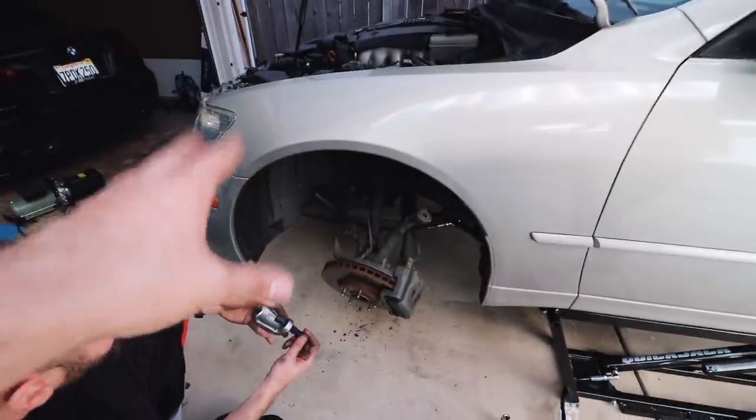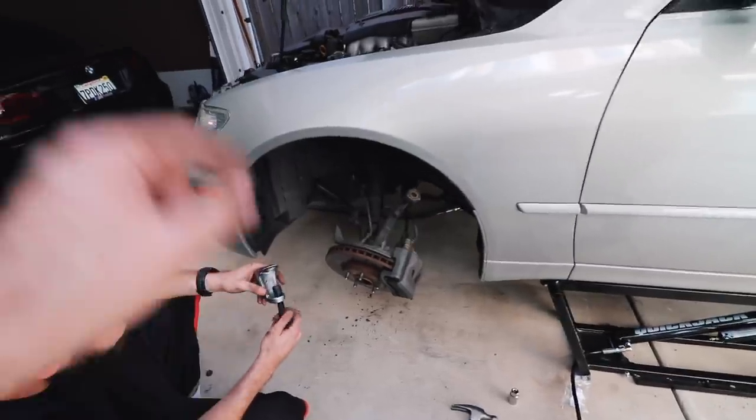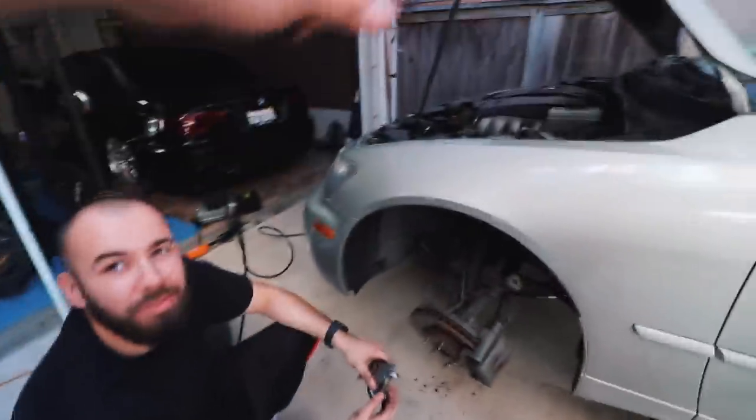We're running into an issue removing the control arm stud, so I sent Chacha and Stephanie to get a special tool. What it does is hook onto the stud and literally force it out — every time I've used it, it's worked. So it shouldn't be too much of an issue. If that comes off, the fronts are going to be cake. We haven't attempted the rears yet, but they shouldn't be too hard.